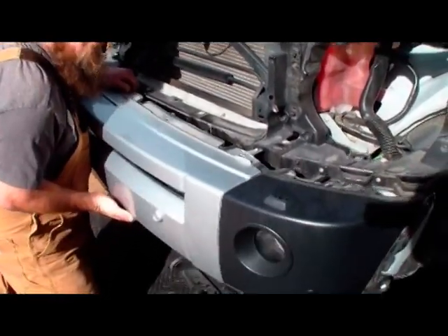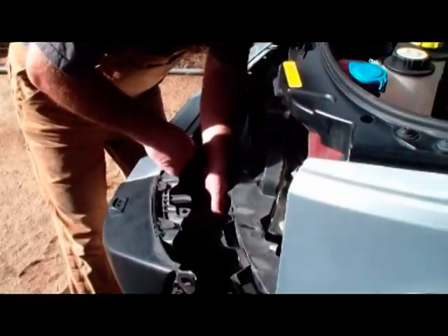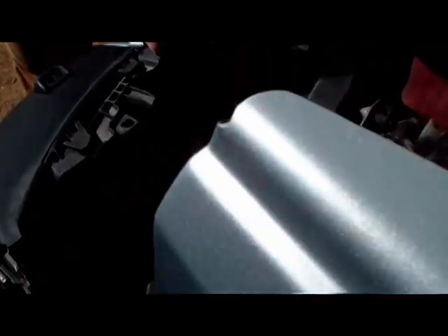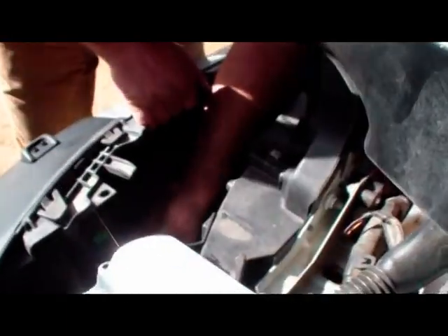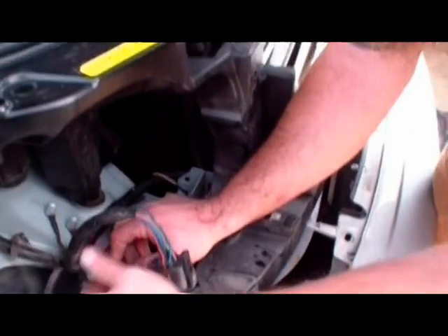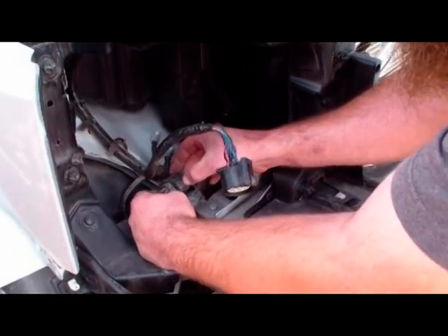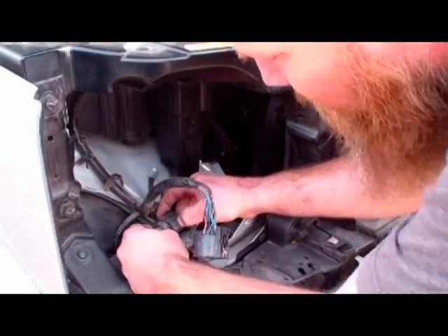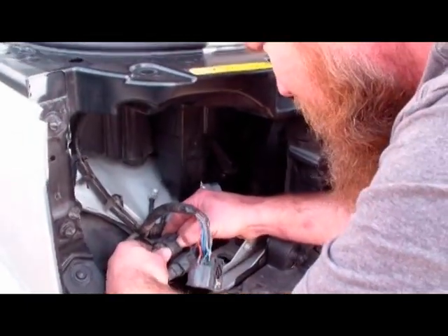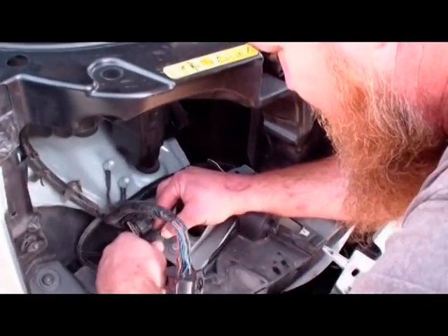This little flashing piece will come out and the bumper is loose — we'll pull it out. It's good if you have an extra hand to get all the wiring in the back disconnected. You can hold it out and put the bumper out while I pop loose the fittings for the fog lights — it's just a little compression fitting.